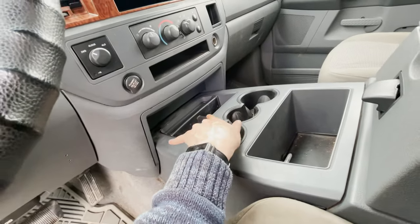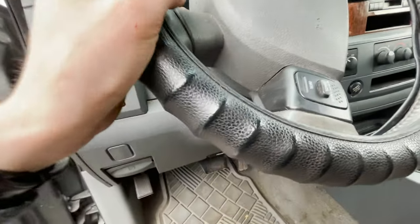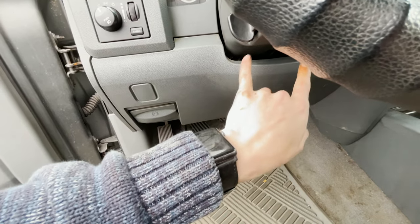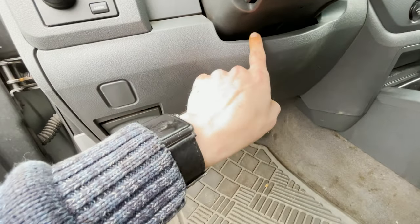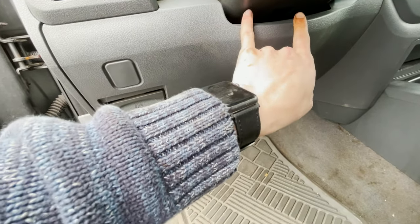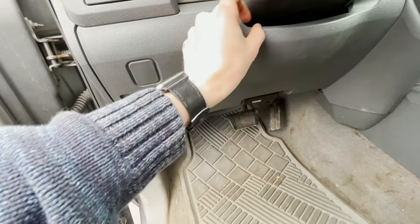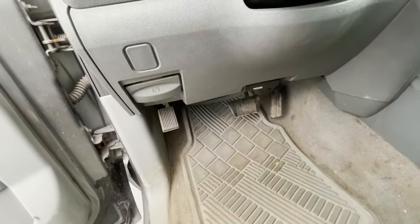You got those two tens that run in there. Also got the steering wheel that goes in first. There's the actual bolts, and then there's four nuts, and then there's two bolts. The top bolts you gotta hold off on until you get those nuts run in there. Those two 10 millimeters. The 13 mils you put on last. You put these 13 mils on to hold it in. And then you can put one on here, one on here. But you have to undo it and then stick that 10 mil bolt up there. Then redo it. And then do the same thing on the other side.